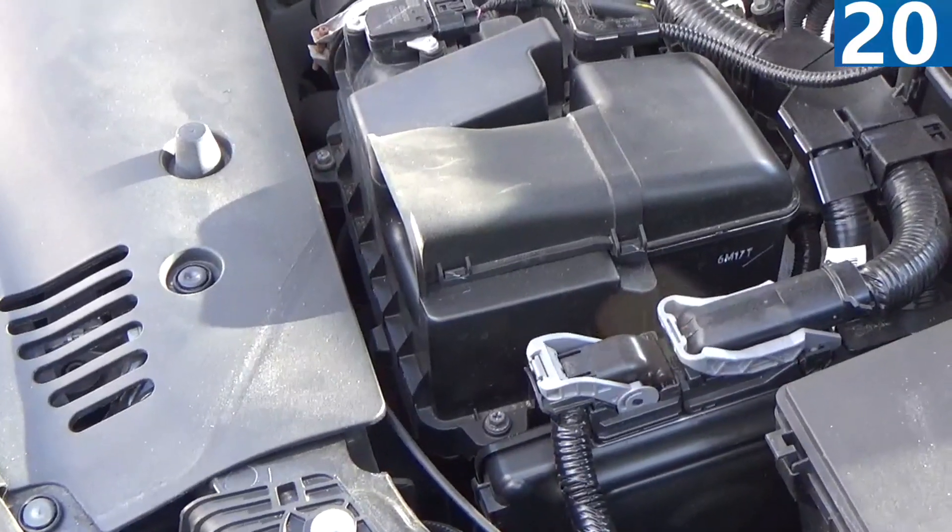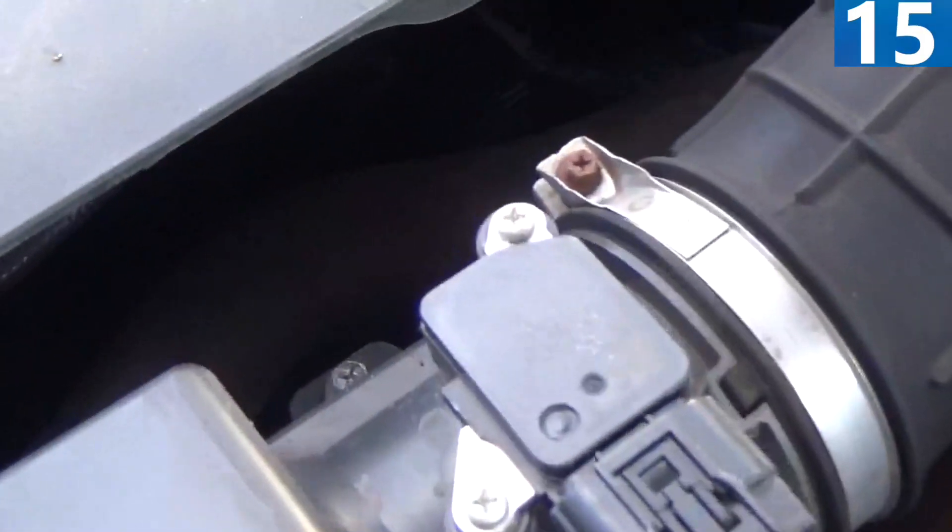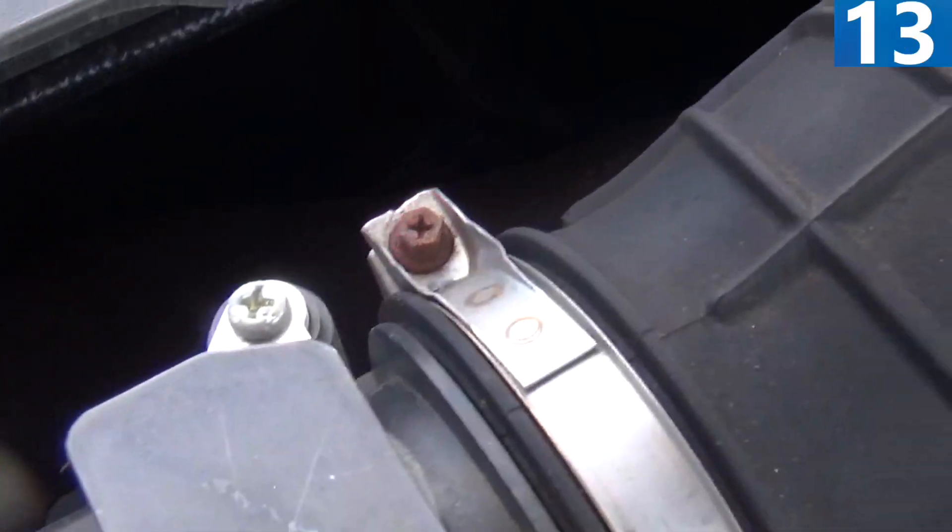If you don't have enough heat in your passenger compartment, the thermostat can be stuck open or stuck shut. Open the hood and find your radiator hoses — there are two of them, one goes to the top of the radiator, one goes to the bottom. Take the temperature of both. If they're both the same temperature and they're under 170 degrees, the thermostat is stuck open.